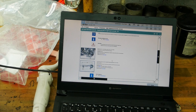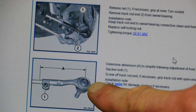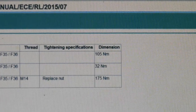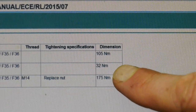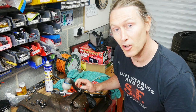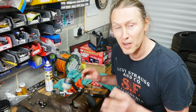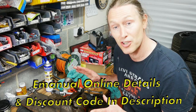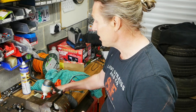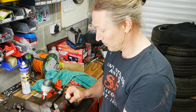I just keep my laptop out here in the garage so I can refer to it quickly when I need to. You can see the outer tie rod here - the locking bolt is number one there, and the torque is only 32 Newton meters, so it's not very high at all. I got that technical manual from E-manual online - they're the same manuals that the technicians for the manufacturers use, so they've got lots of really great content, you can literally just search it up and find whatever you need. So I've got my smaller torque wrench and I'm going to set it to 32 Newton meters.